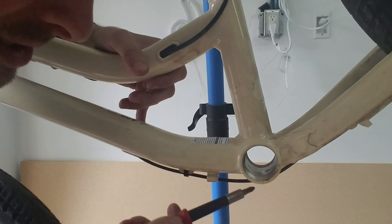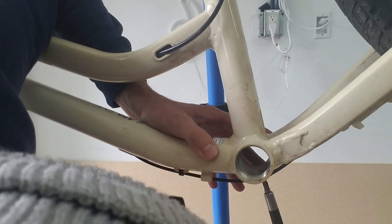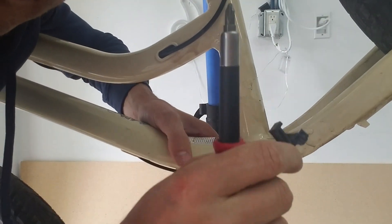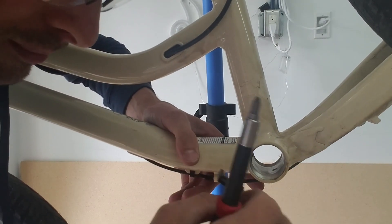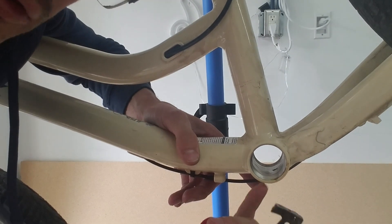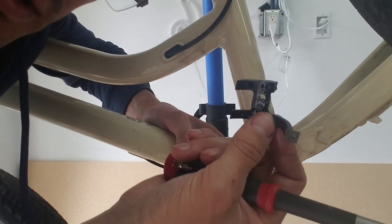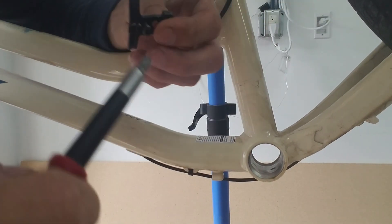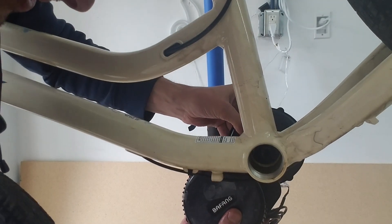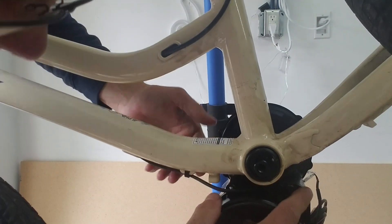What's happening is there's this piece under here that the motor can't fit around — this little thing I showed in video one that guides the cables under the bottom bracket. The motor is too tight to the frame, so this will get removed. These things are not super easy to come by, so make sure that you save it with the retaining screw.